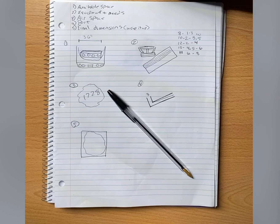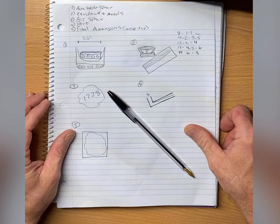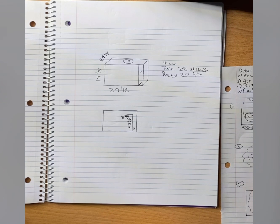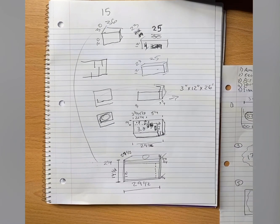This is a box tuned to 28 that will play up into the mid 40s and down into the high teens. And I listen to all kinds of different songs on it. So, it plays pretty well. It's not just a peaky sine box to where it's going to be like a one note wonder. So, good luck with it. Build one and see what you can do. Screenshot the measurements, and that's what it's going to end up being, the final results of it. So, there it is. Good luck with it.